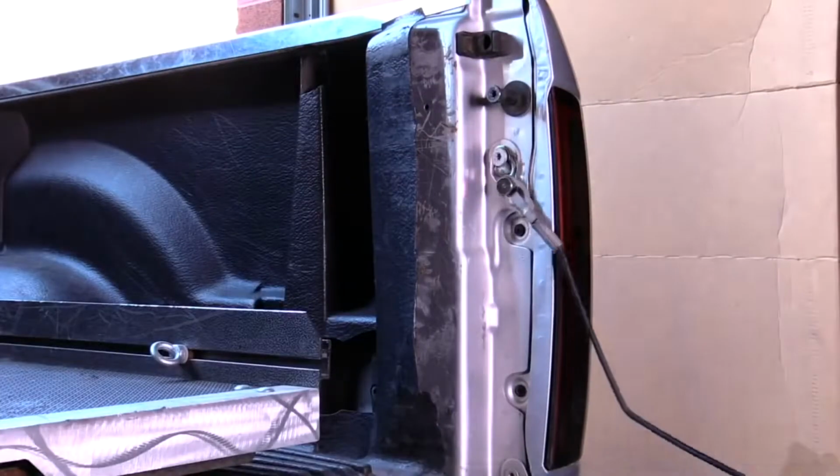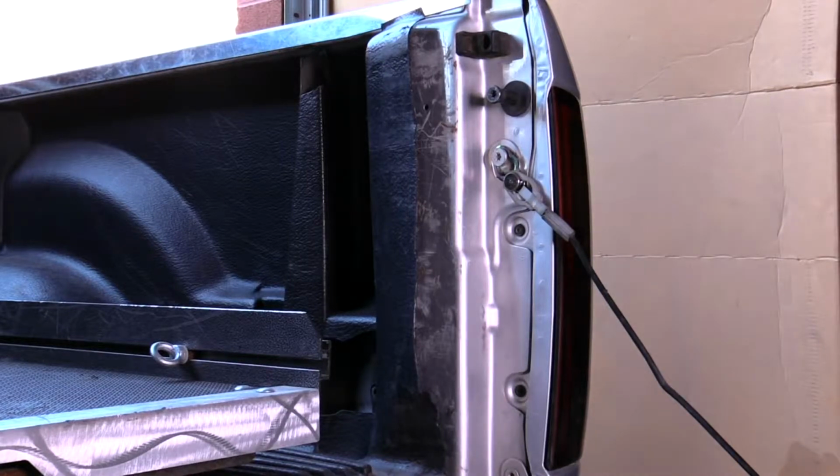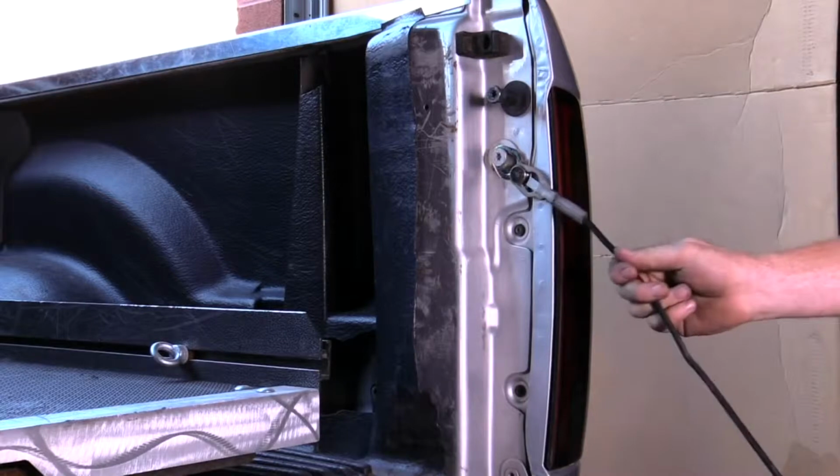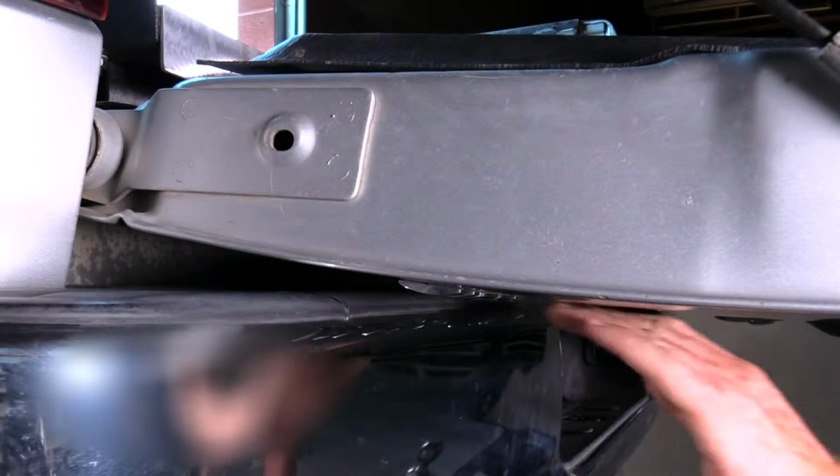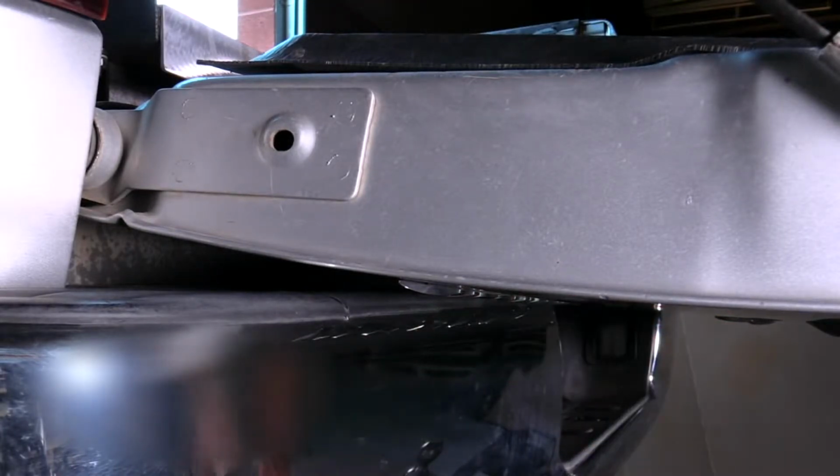As a point of caution, depending on the type of bumper and model of your truck, using a drop link may cause the tailgate to come down too low and onto your bumper, which may scratch or dent your tailgate. So please, check that you have enough clearance before installing a drop link kit.